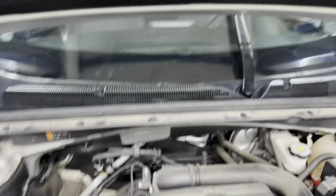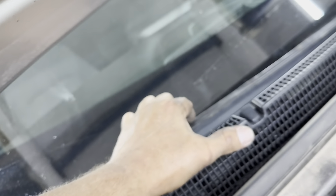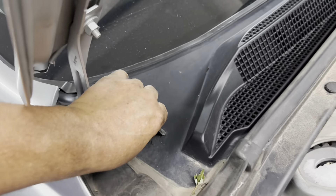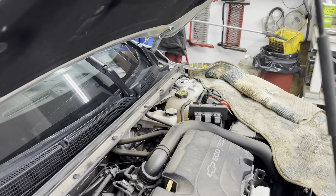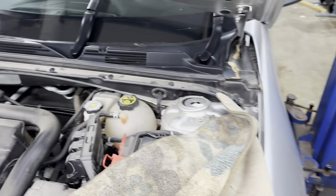Keep an eye out for the panel popping out and getting stuck below. Make sure the weather strip is above the glass and the lower clip goes underneath the glass. When you get to the end, snap it back in. Make sure it looks good. That's it — that's how you do your front struts. Hopefully I helped you out. If so, please subscribe. Thank you.